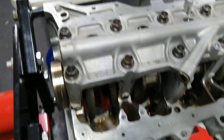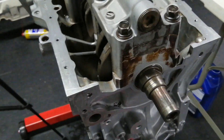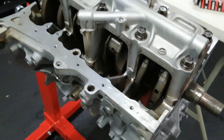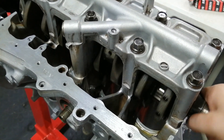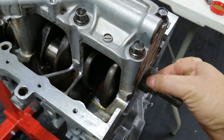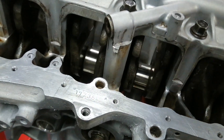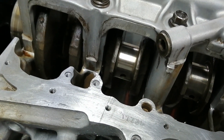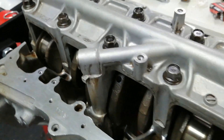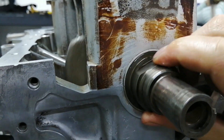The crank is in — it's bolted down but not torqued yet, just bolted down by hand. Checking if it spins freely — very much so. I can spin it with two fingers. I know it's not fully torqued down yet. I did put a lot of oil on these bearings, but this kind of means the bearing sizes are correct. You can see there's no gap, no play.